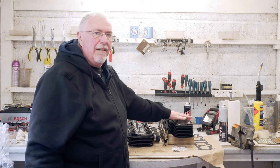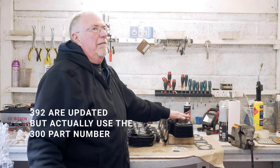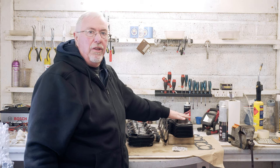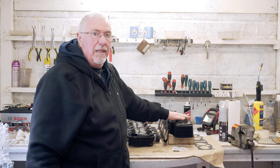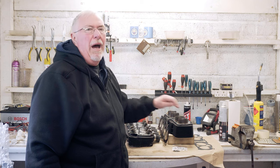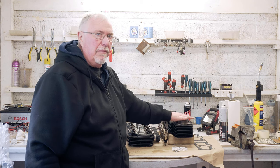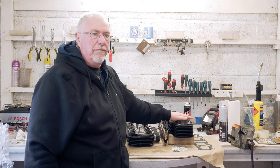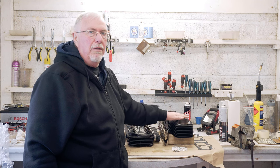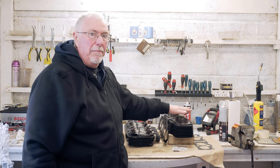I've got three sets of barrels - I think I've got a set of 300, 392, and 410. Some people may think what the hell is he talking about. Well, those are really the numbers of the different generations of engine that Honda made for the CB750 single overhead cam. Within them there is a lot of variety and it can get a bit confusing. Most of the parts are pretty much interchangeable - you can use later ones for earlier ones. However my engine was originally based on a 410 engine, and there are a couple of things about the 410 engine that meant some parts wouldn't be usable after I swapped the barrels. This might make more sense when I actually explain about the barrels and then the head, so let's have a look at the barrels first.